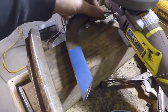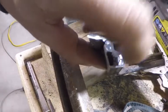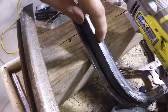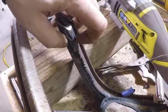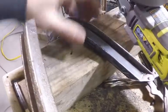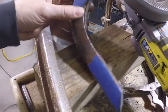And then before I put it together, next step here, after I get everything all cleaned up, I'm going to clean that out and then slide a couple 5/16 nuts in here like we talked earlier, drill some holes, slide the nuts in, and then drill some small, like 3/16, holes here on the side so I can tack those nuts in. So you'll just see threaded holes here so I can make my little brackets to hold this to the crossbar piece, the middle piece of the windshield.